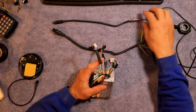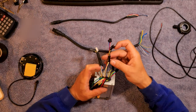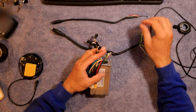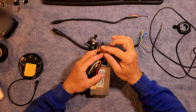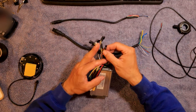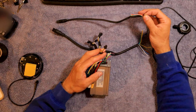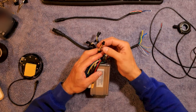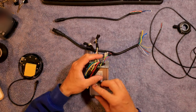On this cable here, I'm only going to be using the brakes — so that is this one right here, the yellow and black wires. I wished I had clips for all these, but I'm just going to clip these wires here. You only have to use one. There's one for the front, the right, and the left. You don't need that because this works for both right and left up front — it splits later on. So just hook these two wires up: the black to the black, the blue to the yellow. All right, the brakes are done.